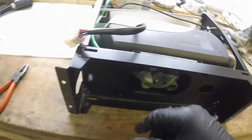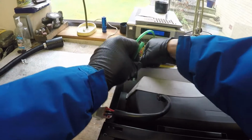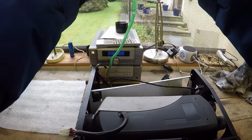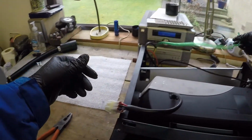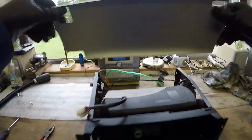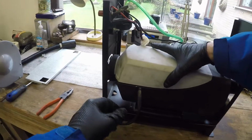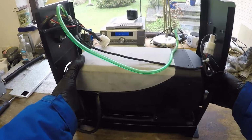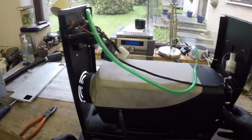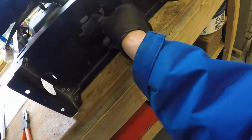I'm gonna have to remove the securing clip off the fuel line, and then thread the line up through. And away out is the line that comes from the pump. Get it out of the road. There's a drop of diesel in that, which I could do without spilling all over the place. Right. The plate now comes away, which leaves the heater unit free to come out. He said expectantly. There we go.